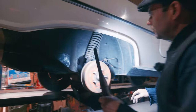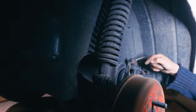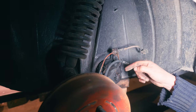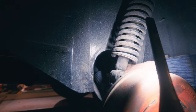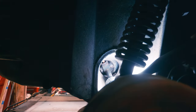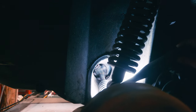Now what we're looking at here - we've got a handbrake cable, conventional sort of sealed here. Brakes coming out to it here. Flexi hose. A coilover shock absorber much like we said before. And then we've got greasing points - we've got 14 greasing points on these cars. Inside the rubber bellows, if I turn it over, you see a little UJ - universal joint. See the grease nipples on it. We need to grease that up. Now that's often forgotten by people, because they don't realise you've got to get up in there.